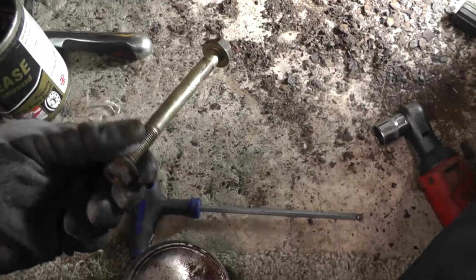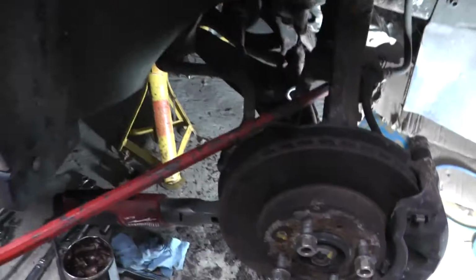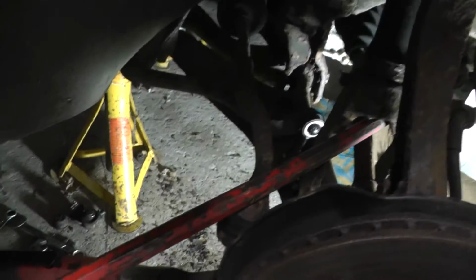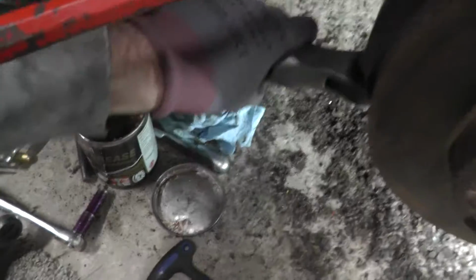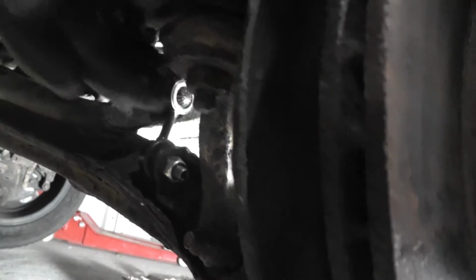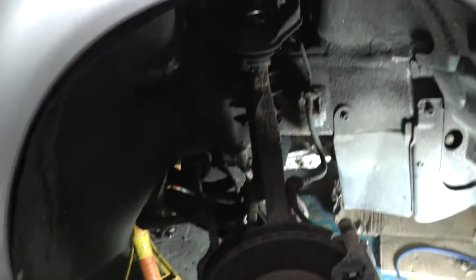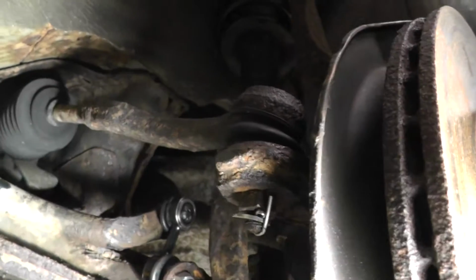And that's it. So you're not going to forget this, which is the long 17mm bolt. It goes straight through here and the suspension fork. Final things to do is pretty much get a bar. I've just hooked underneath the fork there, suspension, and just up that 17mm on the bottom of there for the track rod end, tie rod end, just there. And then I'm just going to put a little split pin through that, and then we are basically done for two of the MOT failure points, so the spring and that anti-roll bar drop link. Yeah, there's the split pin done.